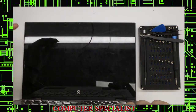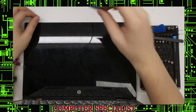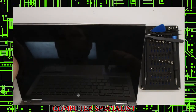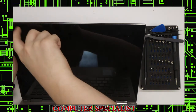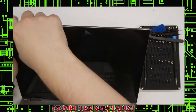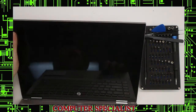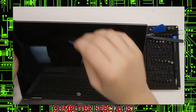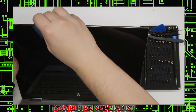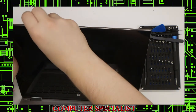You're going to use your pry tool — we use a guitar pick. You could use a credit card or something small that you can wedge in between. On this one, if you look at the top, we're going to start at the top. It has this little black bezel. So they have the actual glass, then it goes up to this plastic bezel, and then behind there is the actual metal. The silver piece is the metal for the back of the screen. We're going to put our guitar pick in between the metal — the part of the back of the screen — and the bezel. So not between the bezel and the glass, but between the bezel and the metal.